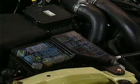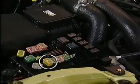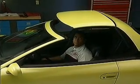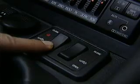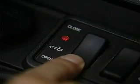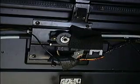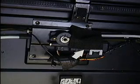Power is supplied to the ECU through a 60-amp fuse in the engine fuse and relay box. While the hardtop is operating, a red LED will flash and a chime will sound at about one-second intervals. The first thing that happens when you press the switch is the ECU supplies power to the door and quarter window motors to open the windows.